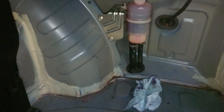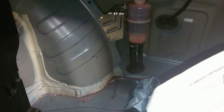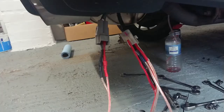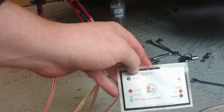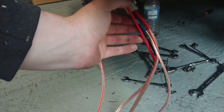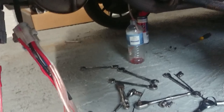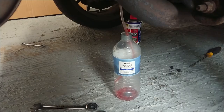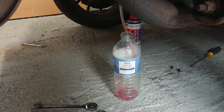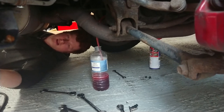I'm happy that's pressurized. I'm going to activate the AYC button on the box when the pump is on, and now we'll actually open the solenoid and start sucking fluid through and bleed the AYC loop. I wouldn't say I'm the thickest person in the world, but that was actually quite confusing the way that is laid out — you could easily mistake that 12-volt feed there for the left-hand AYC. Just something to bear in mind if you're using this box. I managed to get a little bit of fluid out from the left-hand AYC. So these are completely bled now — the left and right AYC loops.